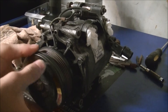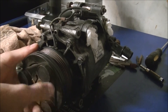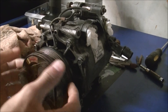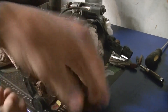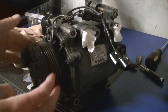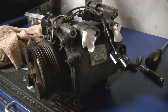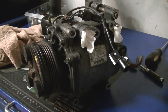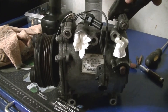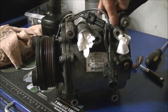Mine has a clutch issue and a condenser issue. The clutch here is a magnetic pickup that connects to a magnet and spins with the pulley when it's engaged. When it's disengaged, the pulley free spins. Mine grounds out to the block, so I'm going to stick a negative cable to the case of the AC compressor.